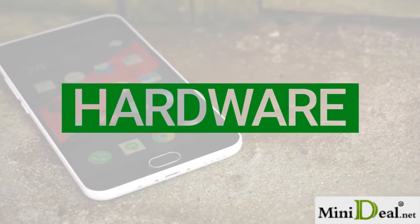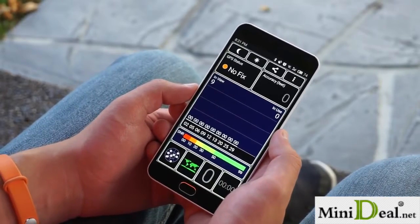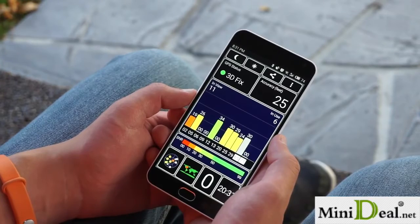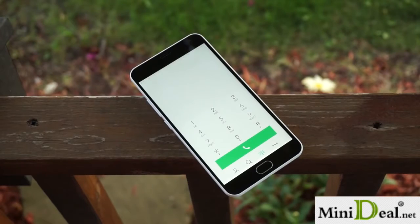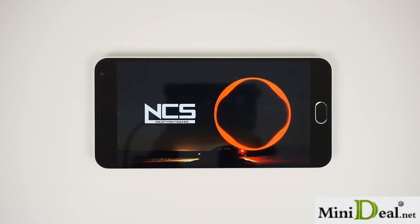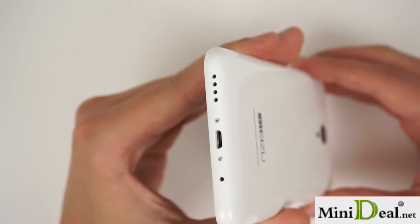The Meizu M2 Note supports 802.11n WiFi, GPS, and Bluetooth 4.0. The GPS signal could be a bit stronger, but it's much better than it was on the M1 Note and should work while using the phone outdoors. Unlike its older brother, the M2 Note supports quad-band WCDMA as well as FDD-LTE and TD-LTE. Unfortunately, it only works with up to HSPA+ on AT&T and T-Mobile, but speeds do seem to be pretty good, at least on AT&T in the Detroit area. The side-firing speaker sounds exactly like it does on the M1 Note — fairly loud, but distorted at full volume. It's unfortunately very easy to cover the speaker while holding the phone, but that's really the case with any phone with side-firing audio.